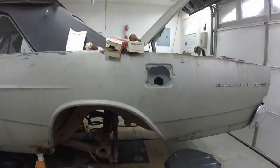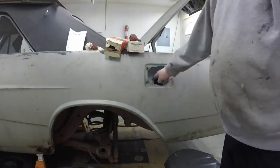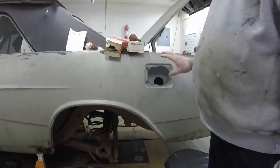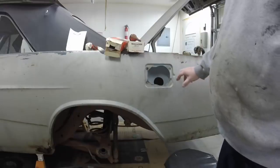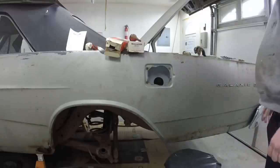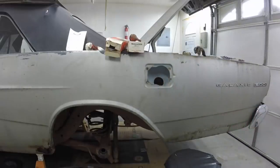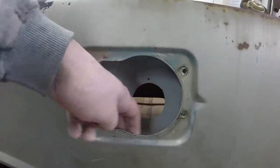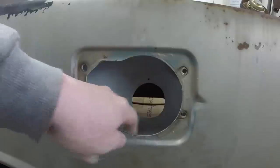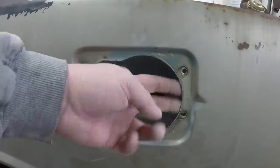First things first, I'm going to get my sandpaper and get in here and sand this out. I didn't drill the holes because I want to put the tank and the filler neck in to have it all installed — I don't want to have the holes in the wrong spot. I'll drill the holes for the filler neck after I install it. My dad commented and asked me why I hadn't drilled the holes. I got it all sanded out and I primed that surface in there, sanded it all out really good first and then primed it.